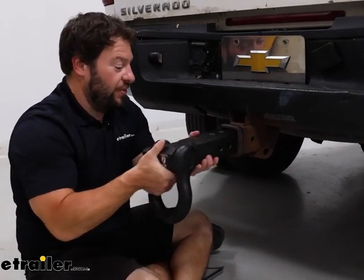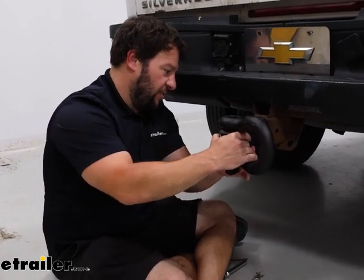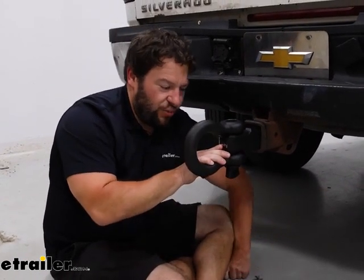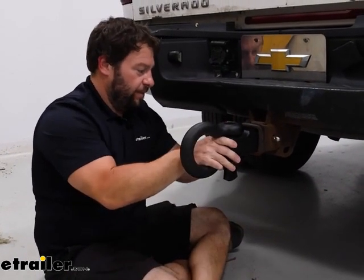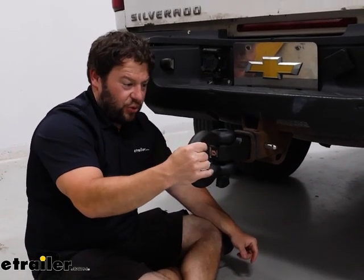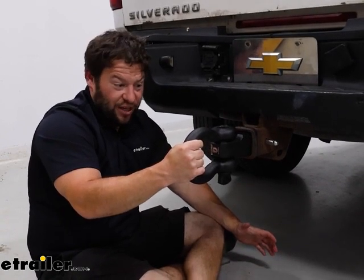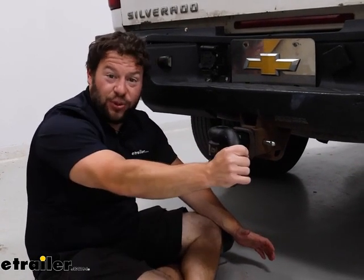Now you can also flip it on the side and pin it the same way. You have those same two options, so if you were to put your pin in this way, you can use the shackle when you hook up to the safety strap this way. So maybe you can't get where you need to in the mud to pull the other person out, you want to pull from an angle, this might help you with that.